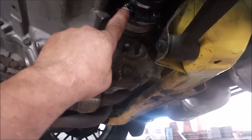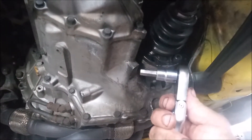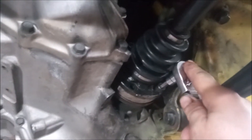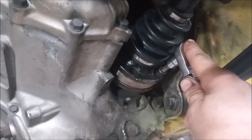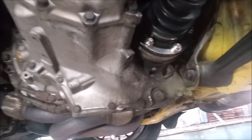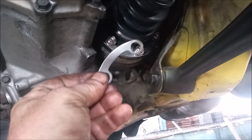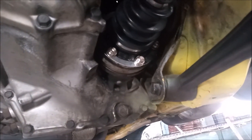We're going to put these new stage 8 bolts in two at a time. These bolts come out with an 8 millimeter hex, and you can usually get them loosened by just putting on the parking brake and making sure the hex is well seated in the bolts. I've gone around and replaced all of the bolts — all six of them — using brand new hardware, including brand new horseshoe washers original from Toyota. They're cheap, so why not.